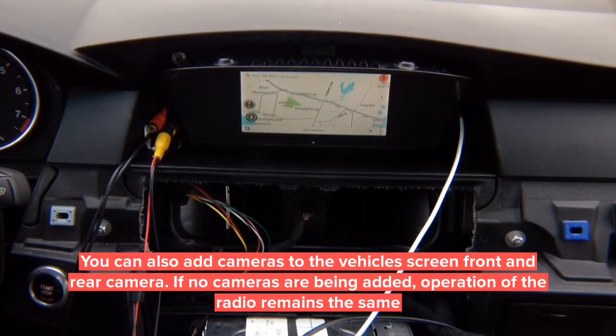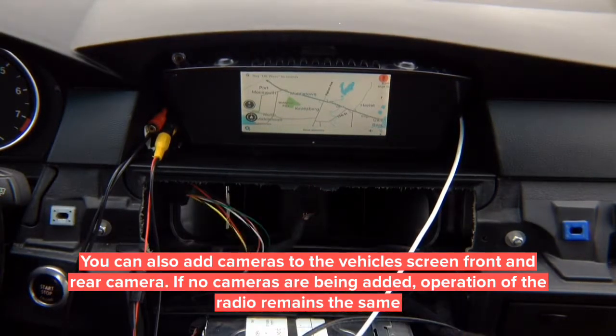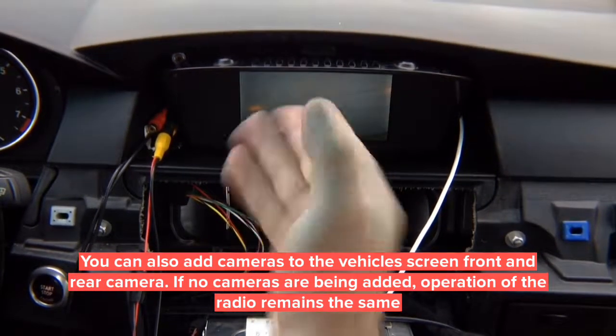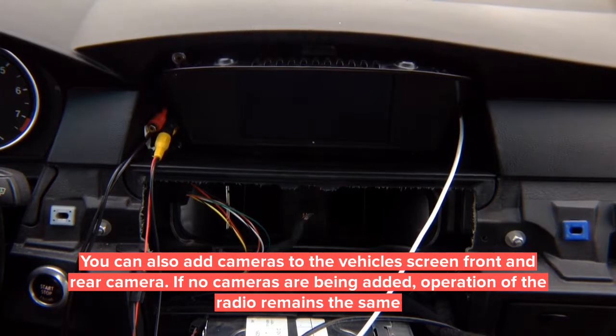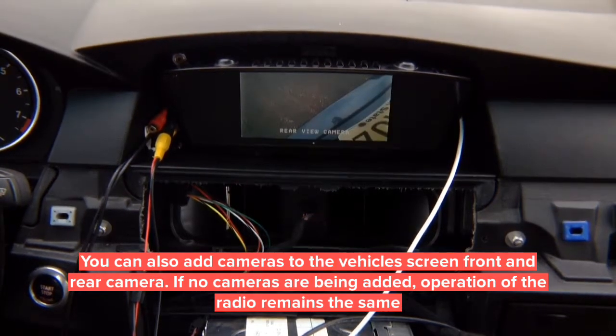If you have no navigation, you can use Google Maps or Waze for navigation via mirroring. It creates a mirror image of your phone — whatever you're running, you can run on the car screen. Showing Waze as an example — if your car has no navigation, you don't even need Apple CarPlay or Android Auto. For a cheaper option, you get a full-screen display right there. Cameras work the same: reverse gives rear camera, drive gives front camera up to 10 miles per hour, and you can manually cycle cameras. If not installing cameras, nothing happens when switching to reverse or drive.